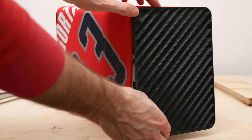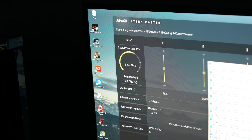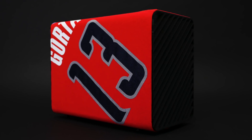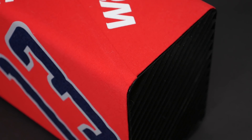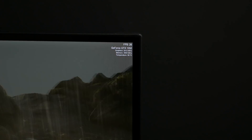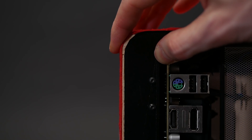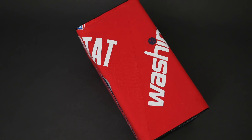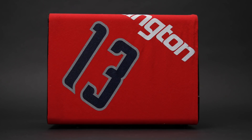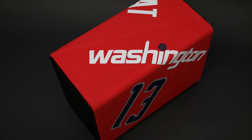I popped on the front cover and the Hammer was completed. On to the mandatory evaluation: the CPU thermal throttles to 3.5GHz when running Prime95, though this is the worst case scenario load as pretty much no real software puts so much stress on the CPU. The video card hits 60 degrees running the Unigine Valley Benchmark, but it's a rather low TDP GPU so that's no surprise. The Hammer is rather quiet even under full load. Design-wise, the frame is missing an anchoring point at the back that would prevent the motherboard from tilting slightly toward the inside of the case — this could be fixed by redesigning the mounting points and joints. The fabric wrinkles a little here and there and would have looked better glued over the entire surface. A printer with a larger print volume would also be nice, but despite all those issues I still really like the end result — it looks pretty cool and very different from what we're used to seeing.